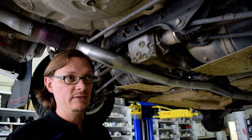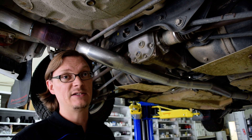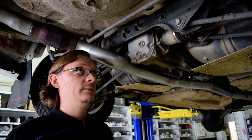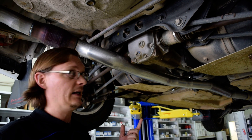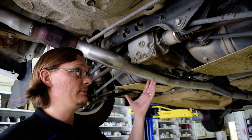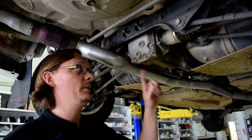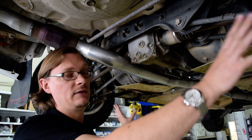You do get some better diff options and a little bit of increase in axle strength over the WRX axles, but again, Driveshaft Shop makes those hybrid axles that are also pretty darn strong. So the rear is really the biggest advantage in staying with the R160. Because the late 06-and-up STI transmissions match up with the 3.545 final drive of the WRX, it's a super simple swap — it's just so much easier to keep the R160 and not have to touch any of the rear assembly.